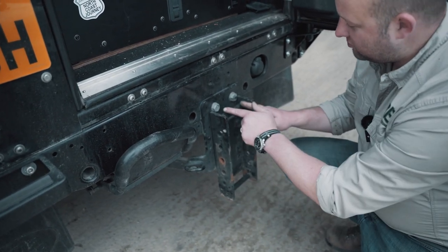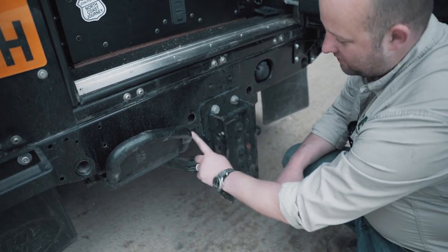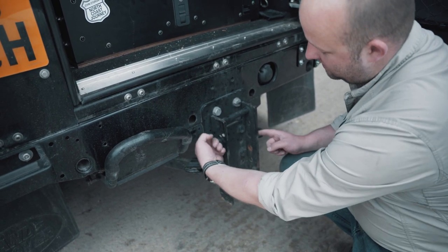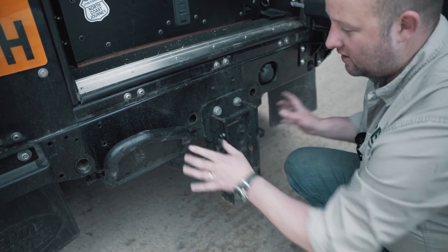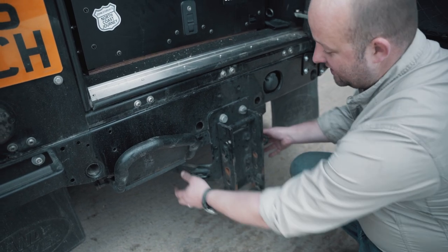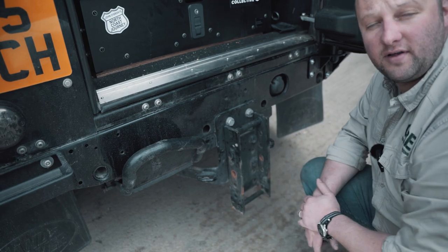Now the step is assembled and ready to go on the car. If you've got a factory tow system, simply remove these bolts here and these bolts here and take this plate off. There's a plate at the back — basically a right-angle bracket with three bolts and one either end and one in the middle. We're going to remove that because our step system incorporates this already. We'll mount the step system on, put the three bolts back in, and then the stays hanging here — we'll put this plate back on those two bolts and those two bolts, and that's it.